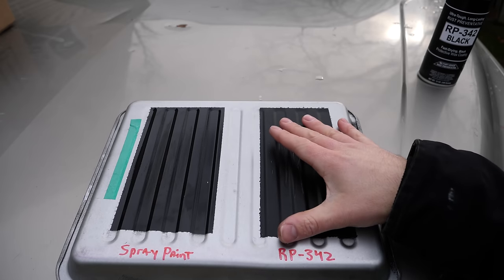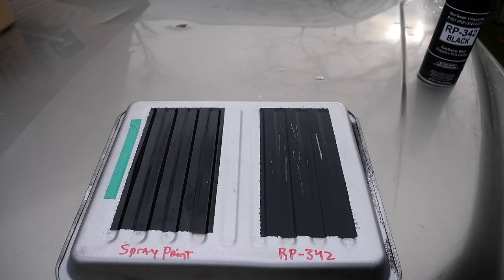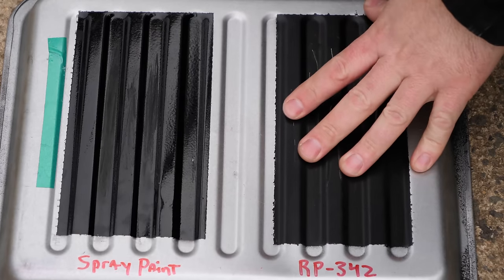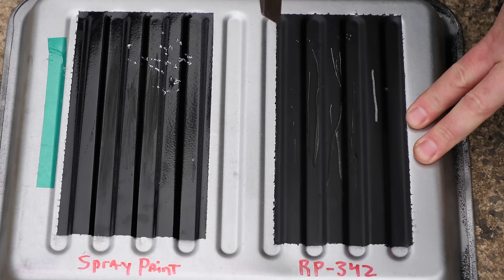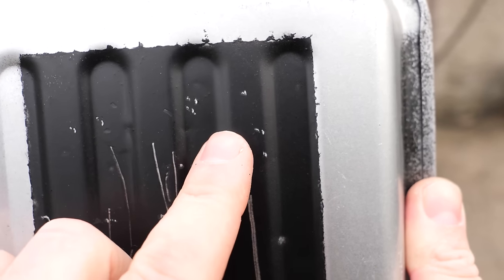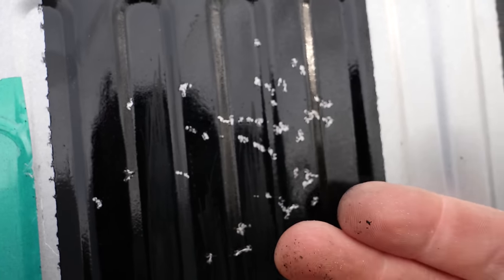GM actually does use wax coatings on their frames. A lot of people seem to have mixed feelings about it. Mine made it — this thing is 17 years old, it's got 244,000 miles on it. Most of that coating is completely dried up and gone at this point, but the frame is still in pretty good shape. There's no flaking of rust coming off the frame. And just as one more demonstration, I'm just going to whack this with a pry bar. You can see right away how easily the spray paint just kind of comes off in big chips. Whereas with the RP342, it just leaves a little divot where the wax just kind of gets pushed out of the way. With the spray paint, the impact cracks the coating and just flakes it away — and then you're going to have rust come in here, grab underneath those loose corners of that chip, and it's just going to completely make a mess.